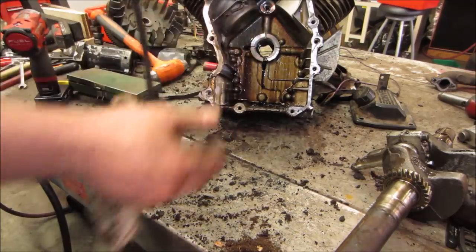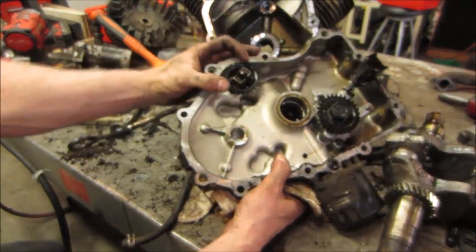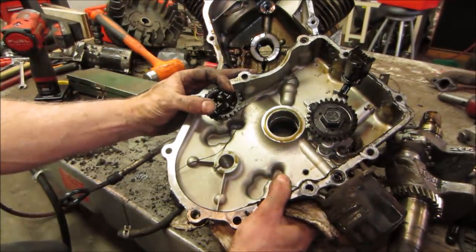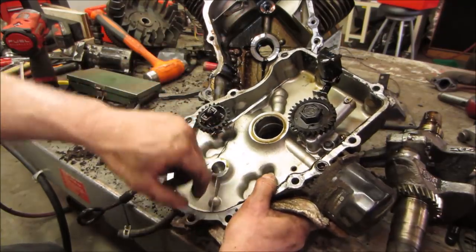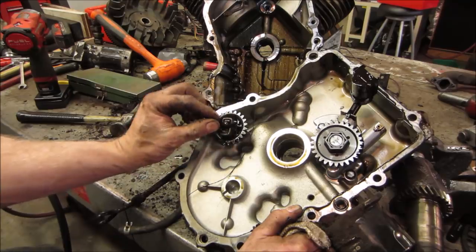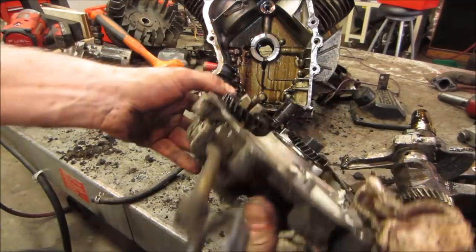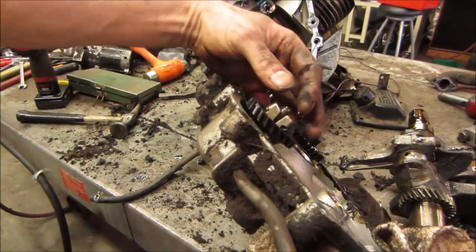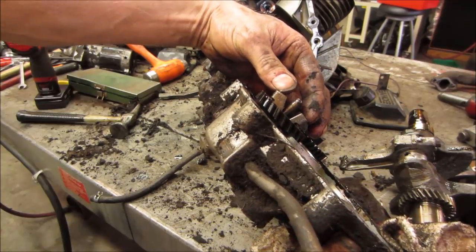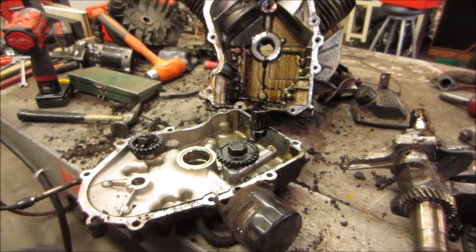So there's a governor, maintains engine RPM. Is right here. Has a couple of fly weights. And that runs off the cam. So this spins off the cam. The faster it spins, the more these weights want to pull out. I don't know if you could see it or not. But the more excited it becomes. Faster, slower. What that does, let's go bend your neck up a little.